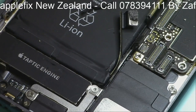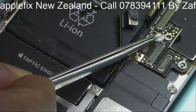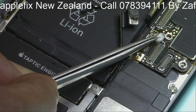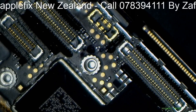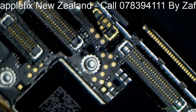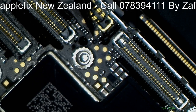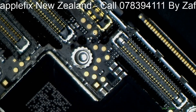The next thing I will do is give it a clean — clean it with isopropyl alcohol. It does charge but it's very, very slow. And after cleaning, we will clean it with low melt solder. We have cleaned the area. This is where we have taken out that MOSFET — do you see those three dots? Let's see, on the board view, why this charging MOSFET is so important.